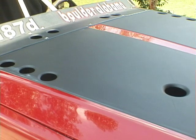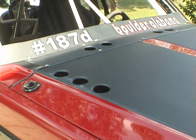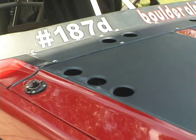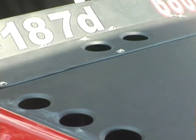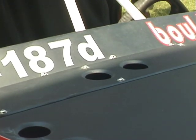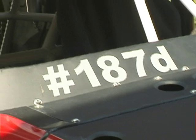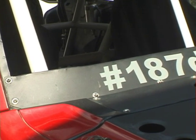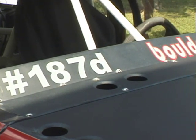The dimple dies allow a lot of heat to escape, keeping hood temperatures down very nicely. Here you can see the cowl — it has been completely redone in sheet metal with dimple dies. The windshield wiper motors and windshield wipers have been removed, with stainless steel mounting hardware and nutserts behind it, so it's not just screwed into the sheet metal. There's also a wind deflector sheet metal with a 5/16 round bar on top to keep it from becoming flimsy.